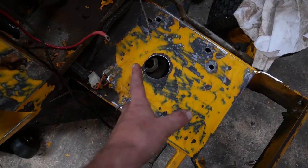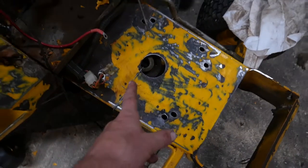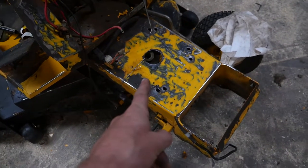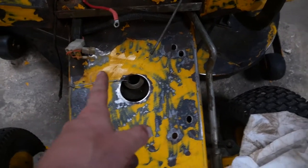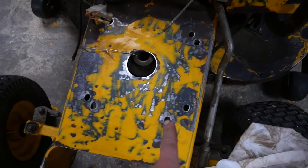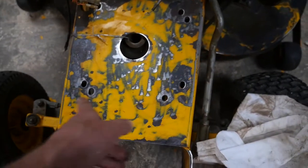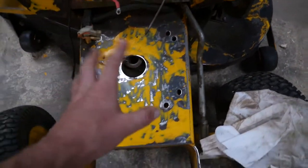The new engine I bought is called a Jono replacement engine. It's actually a larger size that I got, the 17 horsepower model. Same bolt pattern: on the website where you buy it, they give you the measurements to where your bolts go. So I measured it out, it's gonna work fine. If not, I will be able to drill some more holes, but it should match the Briggs & Stratton motor that was in there anyway. So yeah, that's the little project.